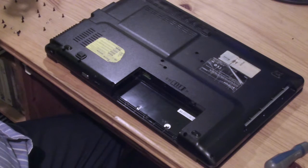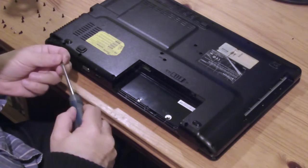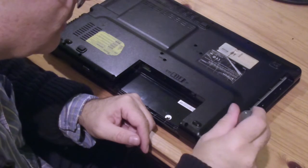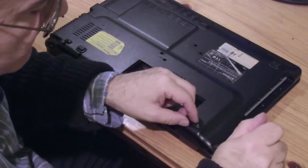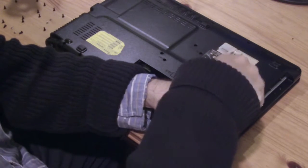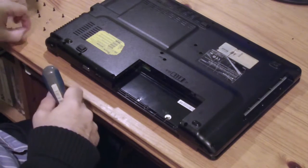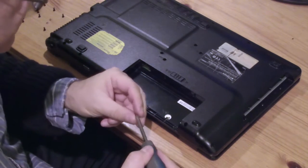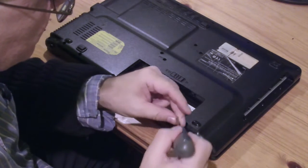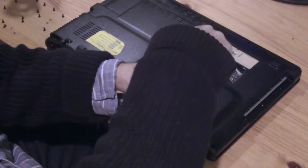I hope this has thermal contact of some sort, to some degree. And I just have to make sure I remember to plug this thing in with the black cable towards the edge of the case into this little socket here. It's a little 3-pin connector. You need to be kind of careful not to bend any pins, etc. Pop it in and that's done.